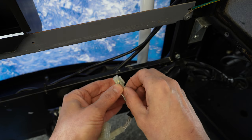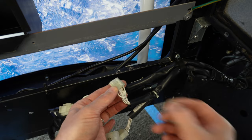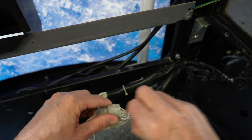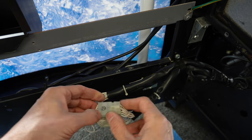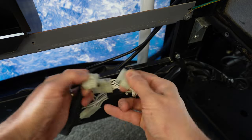What you'll find with a loose pin is that when you pull back on the wire, the pin actually pulls out — meaning when it's loose and you go to plug it in, the wire gets pushed back and doesn't make a good connection. That's a quick way to determine if you've got a pulled wire or a bad plug.